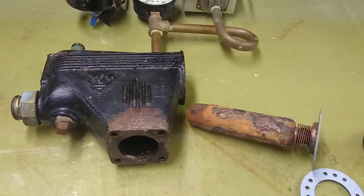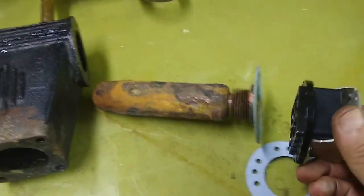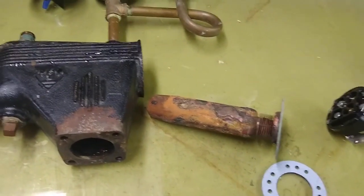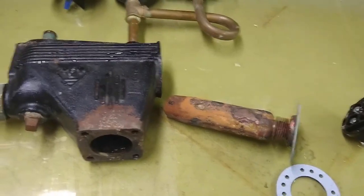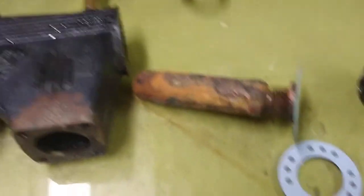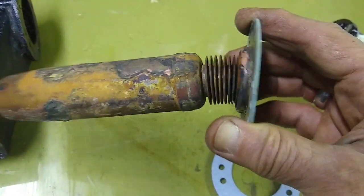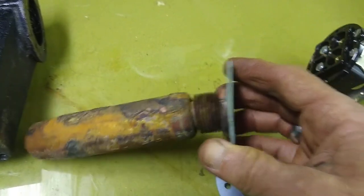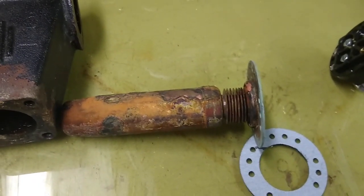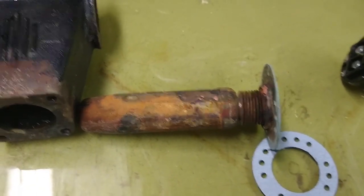Which I did. I removed the switch from the back of the float, then removed the float after having removed enough of the scale from the inside to allow me to do so. When I got the float out, what I found was that essentially the hinge — this accordion-shaped thing at the end — was all clogged up with muck and partially solidified scale, but it was still fairly soft. That was what was preventing the float from moving up and down. It was just all bound up in there.